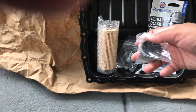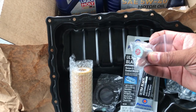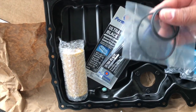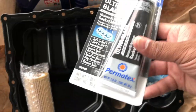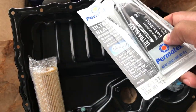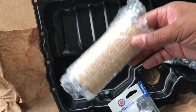Here are the materials needed for the oil pan. I got the tool to take off the oil filter housing from ShopDAP, the Deutsch Auto Parts magnetic drain plug, the seals needed for the oil sensor and oil filter housing, and the bolts to secure the oil pan. The plastic oil pan has a gasket, but the steel one doesn't — you have to use sealant around it before torquing the bolts down. You also have the replacement oil filter for the housing.